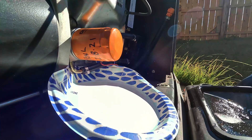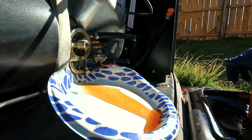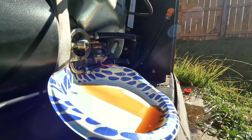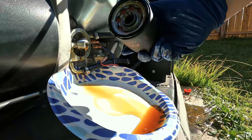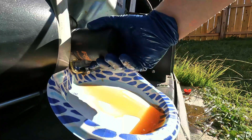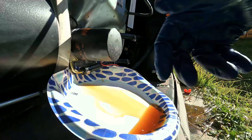I'm going to move my oil drain right over to catch the drips. Now I'm going to put the new oil filter on. Use some of the old oil to lubricate the oil seal — make sure you don't have another seal still on there — then screw it on. You just want to make it hand tight; you don't need to tighten it too hard. Hand tight should do just fine.